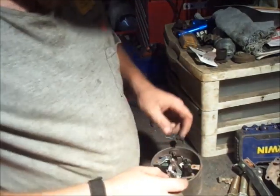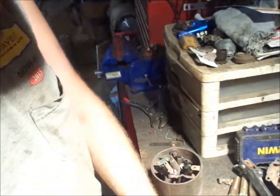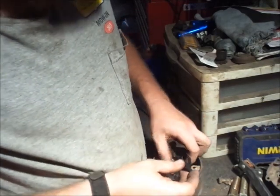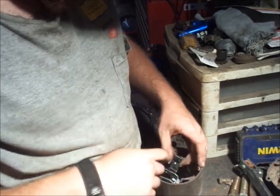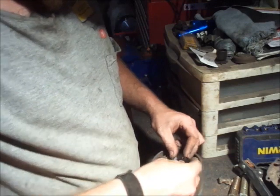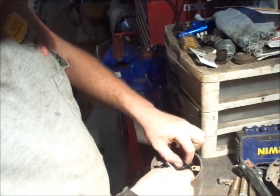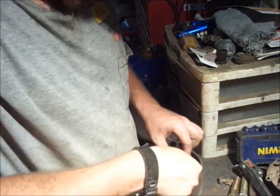Okay, that's tight. So, one trick I got to say about this is you want to start the spring on the black plastic brush holder first, and you may say why. Well, it's not hollow on the back; it's solid. So when you put it in there, the spring won't kick around, and it sets the depth. So basically, you can pretty much set the spring down in here.